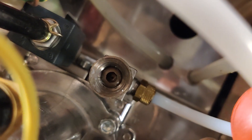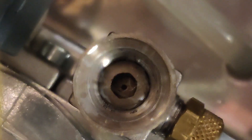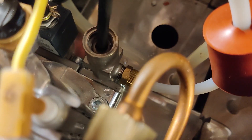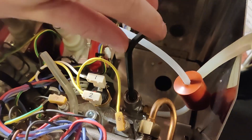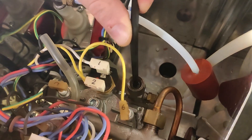Inside on my machine there is an allen head socket. I can put an allen key in there and turn it to adjust the pressure. The hole in the middle takes a 5mm allen key, and you'll know when you've got it in because it drops right in. I'm just going to turn this anti-clockwise by about 45 degrees. Done.